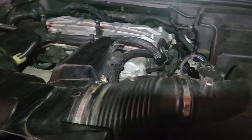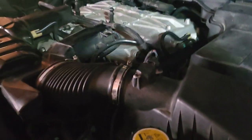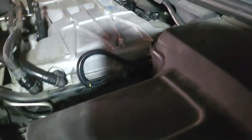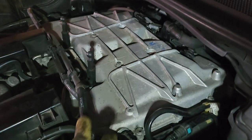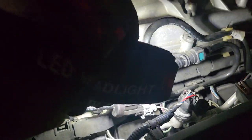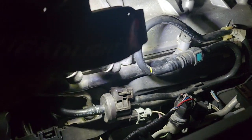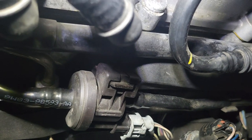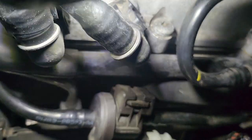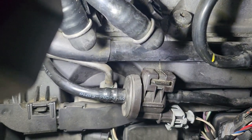With today's cars there's a purge valve which generally tends to be in the engine bay, and in the back of the car usually the charcoal canister as well. I've got the front cover off — that's my supercharger there — and I'm going to show you where the purge valve is on this car. You see this brown device right here on the driver's side, above the valve cover? The one that's got the electrical connection on it — that brown one — that is the purge valve.